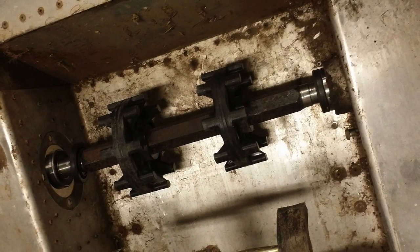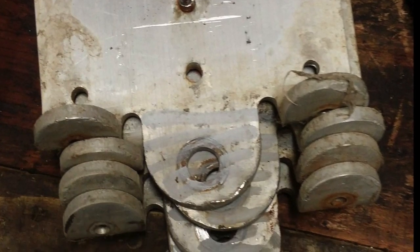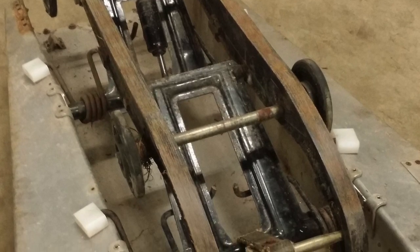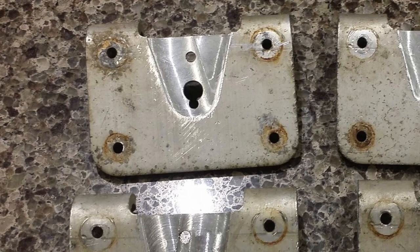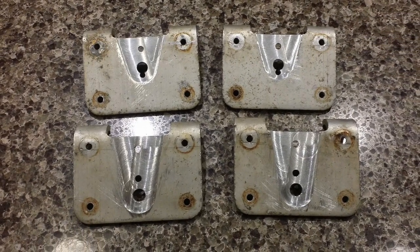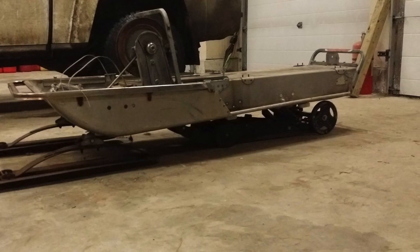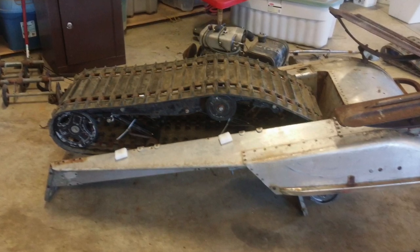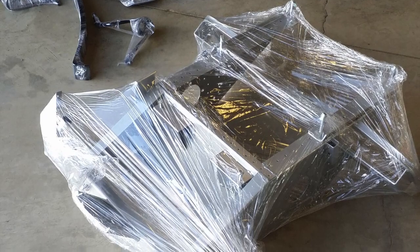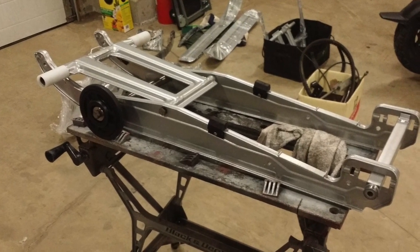Here's the driveshaft test-fit into the chassis — everything seemed to fit okay. These are the original hangers that were used for the bogeys; I opted to reuse them. I remachined the tabs off where the bogeys would go on, then calculated where the holes would be for the mounting points on the suspension, and machined little slots in to help guide them when setting it into the tunnel. Here's the first test fit with everything and the suspension put underneath it — no track yet. The bulkhead and suspension components were pretty rusty, so I sandblasted them and had them powder coated. Looks really nice.